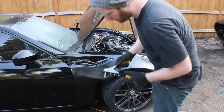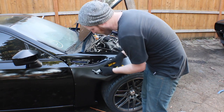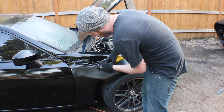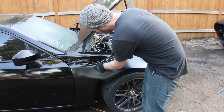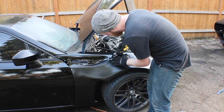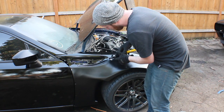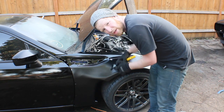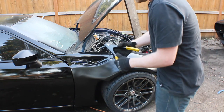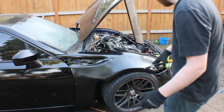Riveting pro tips so you don't mess up your own car. When you're putting the rivet in, you naturally want to be pushing towards the car body really hard. You're clamping down and your body will build up a lot of pressure going towards the front of the car. When you're about to push it for the final part where it's going to snap that rivet off, you want to actually reverse that and start pulling backwards. Because if you're pushing forward and this thing snaps and pops off, your rivet gun goes into your paint job and scratches up your car — I've done it a couple of times. So once you're about to snap that rivet off, start pulling backwards and hopefully the rivet gun will pop back on you.